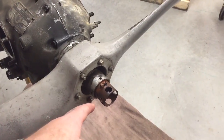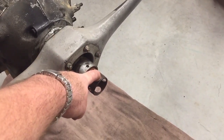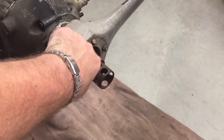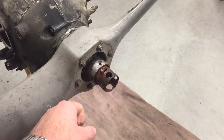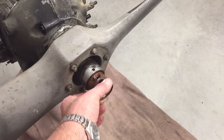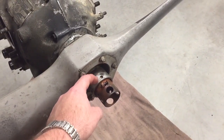There are articles you can find that say to stick a five-eighths bolt through here — a three or four-inch bolt — take a cheater bar and put it on that bolt and turn it. It says there's about 200 to 225 pounds of torque on this nut. This is a nut that spins inside of this part here.